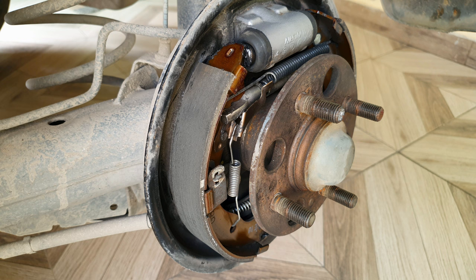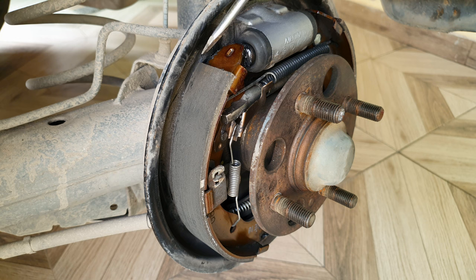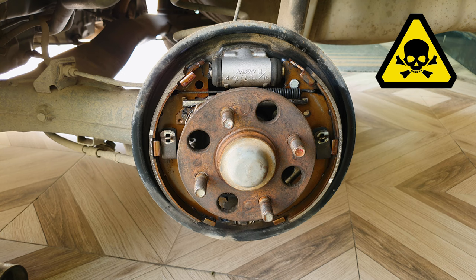There are a few grease points that prevent the brakes from squeaking or squealing. At the ends of the brake shoes where they meet the piston you have grease, and on the other end also. Where the brake shoe touches the backing plate there are three raised surfaces where you put grease — one in the middle and one toward each end. You can use any anti-seize grease or moly grease here. If you get any grease on the brake material, make sure you wipe it off.